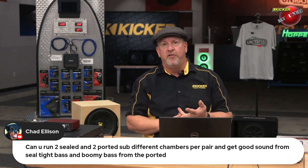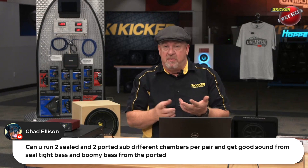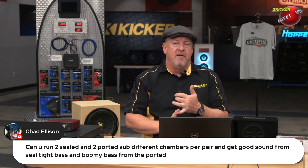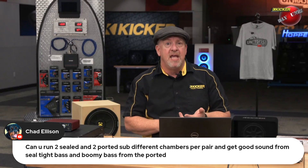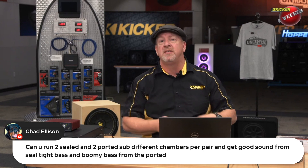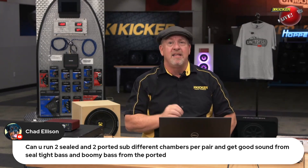Do's and don'ts with boxes: do not mix and match sizes of woofers, even if they have their own separate sealed chamber — especially if you're going to play them at the same frequency. If you're running a 15-inch from 50 Hz and down, then an 8-inch from 50 up to 120, then midrange, that's fine. But don't take a 10 and a 15, put them both in their recommended sealed enclosures, and play them at the same frequency off the same amplifier, because they will not react the same.